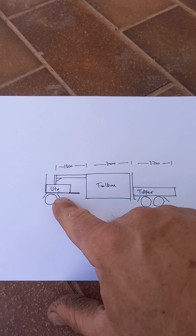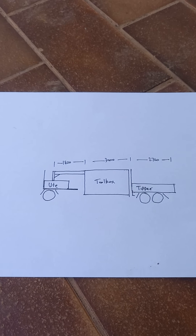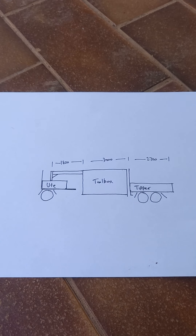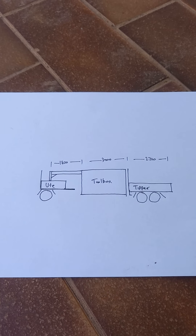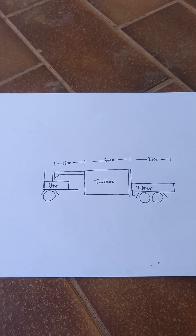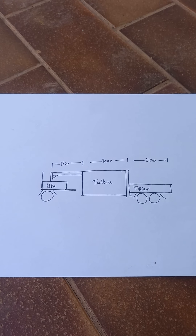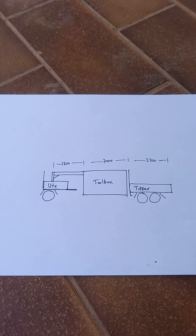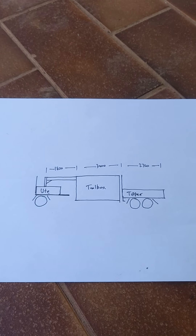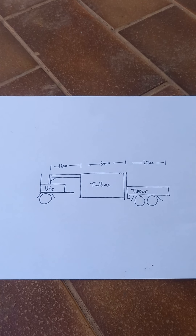One of the reasons I've decided to go this way is that I've had an issue with the ute pulling this particular dog trailer that I built. The stability control gets upset by the dog trailer when you go around corners, because you've got two pivot points. As a result it automatically limits the acceleration on the vehicle when you're not going in a straight line.